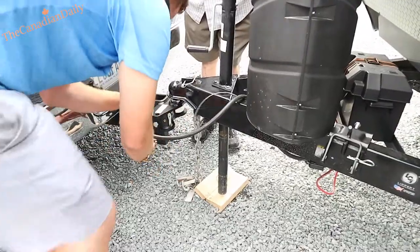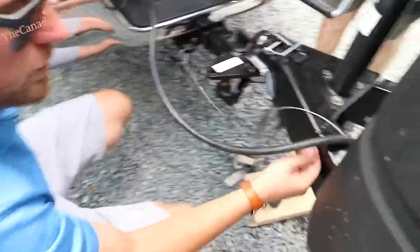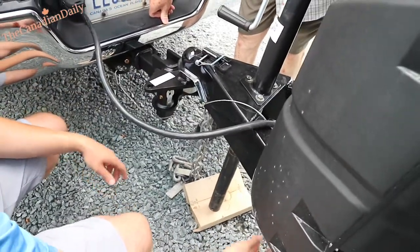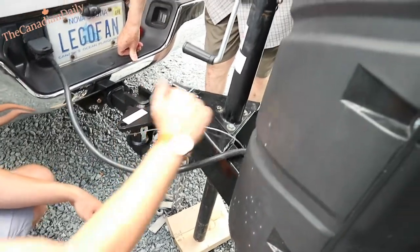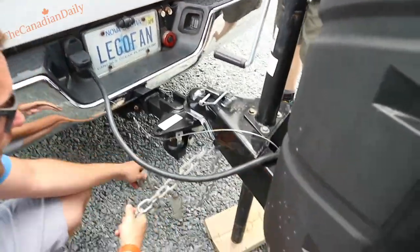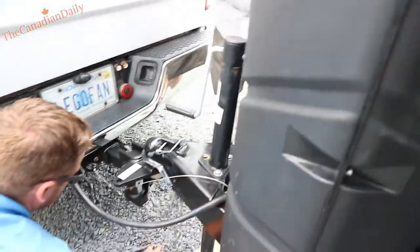By law, they want your brake pull-away attached separately to your hitch — don't bind it over rubber. If your trailer ever comes away and everything fails, it'll pull this little guy out and lock up your trailer brakes, as long as you have batteries attached. For chains, cross them — left goes to right and vice versa.